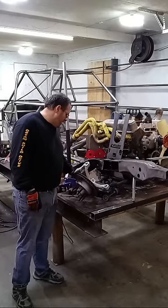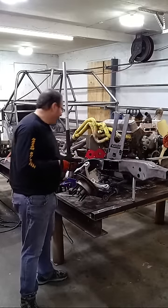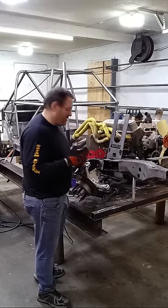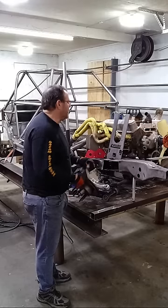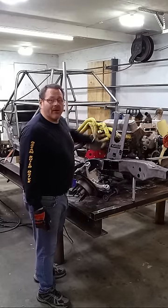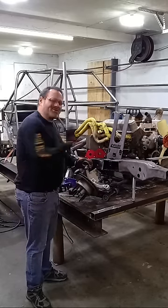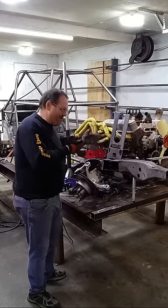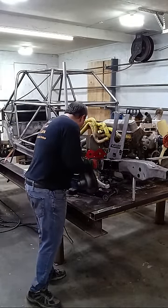I've come to the conclusion that roll centers are not near as critical as we think they are. It's like, instead of talking about eating a sandwich, we can just go straight and eat the sandwich. That's not a good analogy. But anyway, on the roll centers, what I realized is I don't actually care where the roll center is. I care what this camber curve does. We're trying to move the roll center around to get a camber curve. Why don't we just set the camber curve and quit worrying about the roll center? Because that's what we're trying to do with it. So I got to figure out between now and when I film all that, maybe tomorrow or the next night, exactly how I'm going to say all that in a way that makes sense. I'm still working on it. You can see I'm kind of working through it right now. Anyway, okay, back to this.